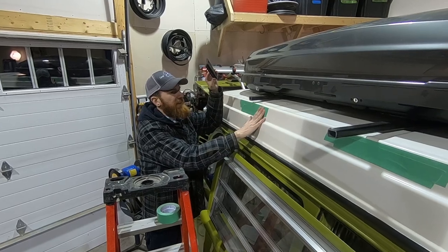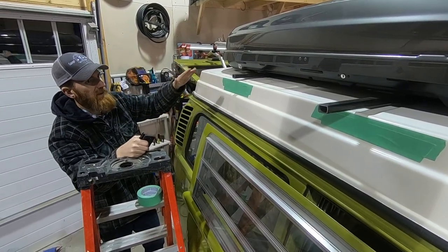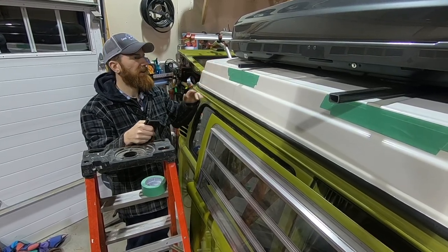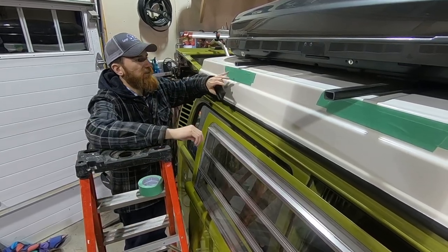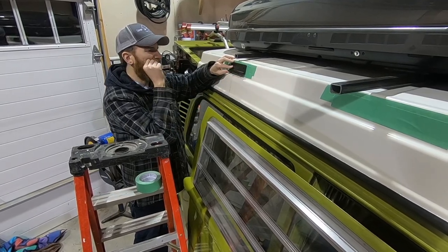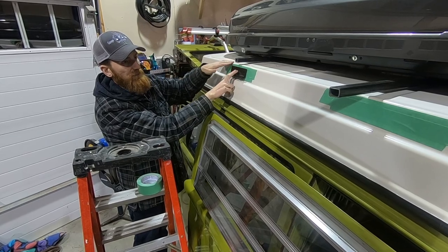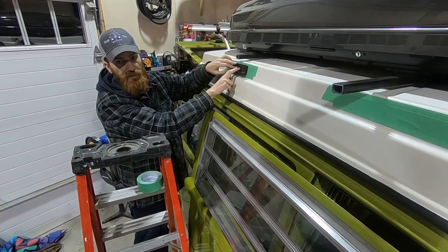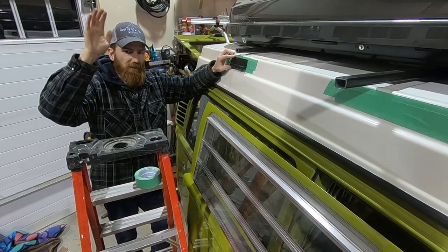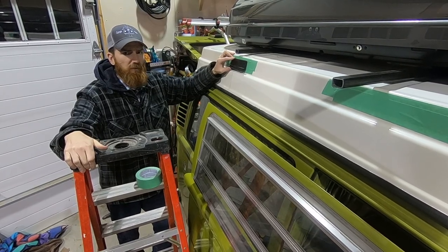Looking at the side of the bus here, I've put some tape — we've just set the cargo box up here to make sure that it aligns. We've got the back rack up so that the bikes don't hit it when it's up. I'm trying to place it as far back as I can because obviously I'll have to lift up the pop top, and if the weight's at the back it'll be easier to lift. So I like the positioning — it works with our cargo box. I'm going to mount these higher rather than lower; there's some wood support in the roof here as well so it'll give it a bit more strength. Before we go ahead and mark this and drill, we're just going to take off the rack and check that there's no bracket or anything interfering with where we want to drill our holes. Last thing I want to do is drill my holes and find out that the lifting mechanism is on the other side and I can't access it to put the nuts on.